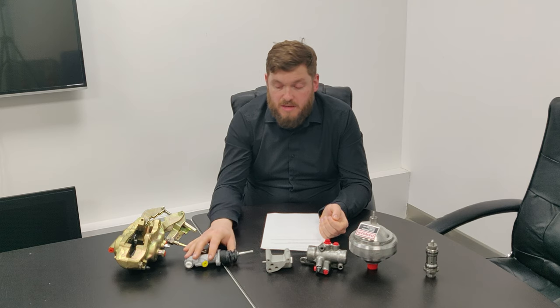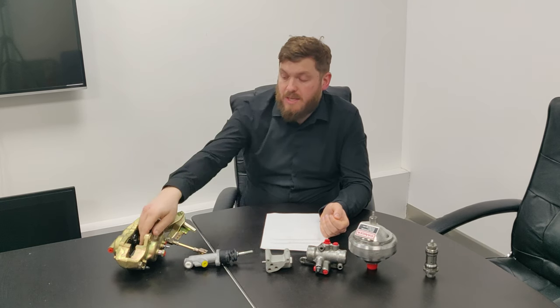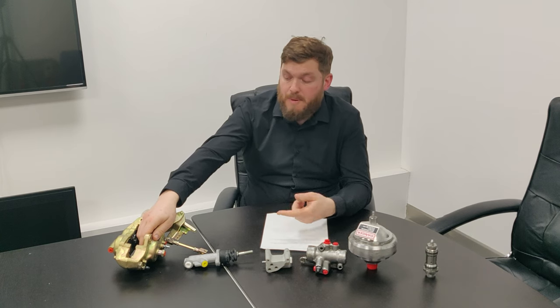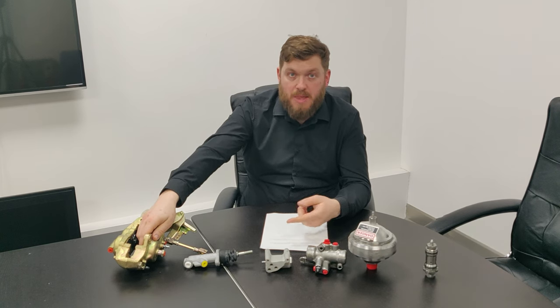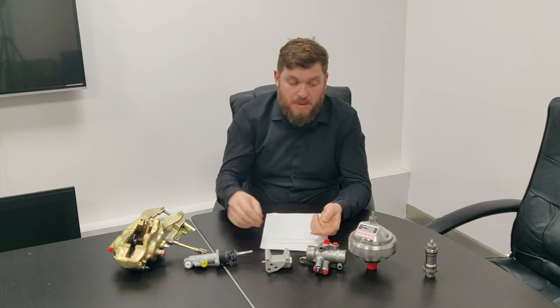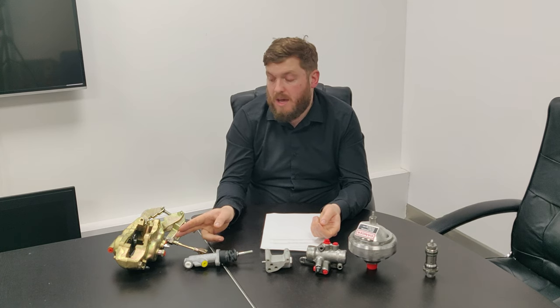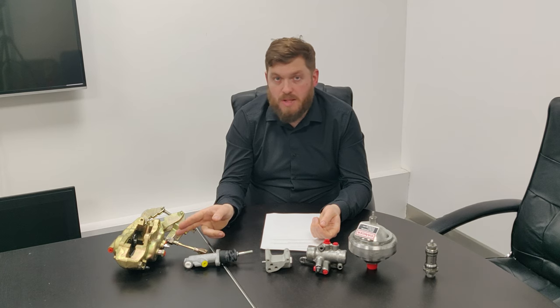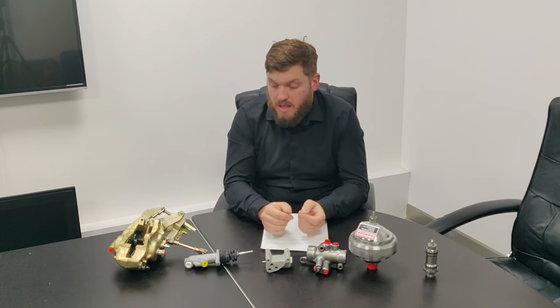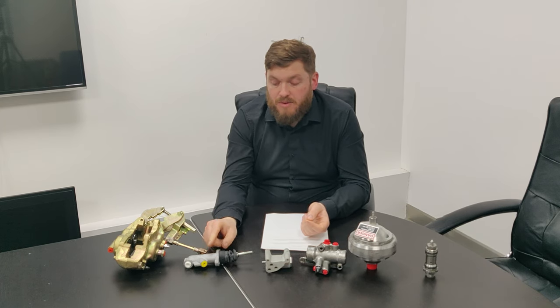After, I think, 20-odd thousand chassis range, they do away with the master cylinder, and then the rear calipers, both systems, are fed by the power system. I can't remember which way round, upper or lower, but you won't need to worry about bleeding out the master cylinder first. Just the both bleed screws, you can treat them like the normal power system bleeding, like the fronts.